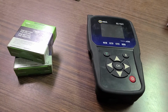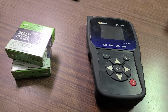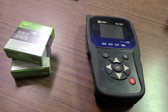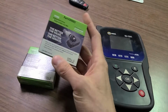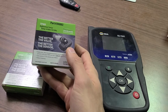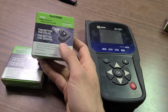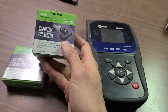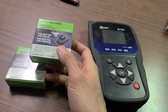In today's video I will show you a quick process of what you have to do before installing new TPMS tire pressure sensors on any vehicle, especially if you are getting aftermarket TPMS sensors. You cannot just go to the car parts store, buy the sensors, have somebody install them onto the rims and have it done, because the vehicle will not recognize it. First you have to program them to a specific vehicle and then they can be installed, and after that the vehicle will recognize them.